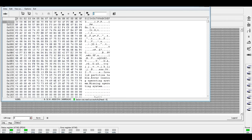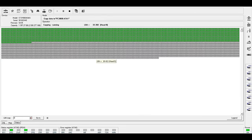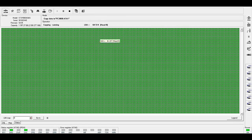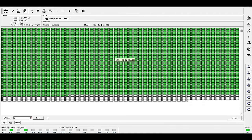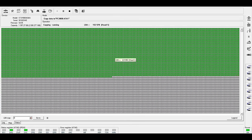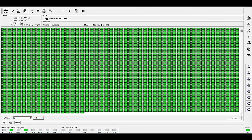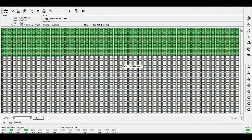So what I'm going to do now is, you'll see that this is head zero. I'm going to go ahead and start the cloning process, and head zero is cloning marvelously. So each green sector is now automatically duplicated to the destination drive. So this is a great way for recovering data off a drive that's problematic. We're now on head one, head two,